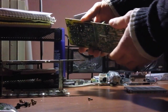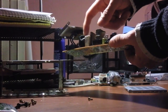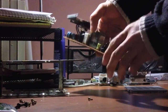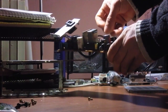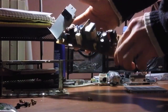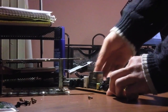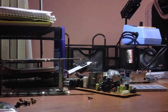I already replaced all the electrolytic capacitors, except the 400V main one, because the VCR was exhibiting a particular problem of not powering on. Although it displays the clock, when you press the power button the display will just flicker and nothing goes, and the tape wouldn't be loading. So you can troubleshoot individual components as you need to. You can see my other video for how to troubleshoot the power supply on the Sony VCR.